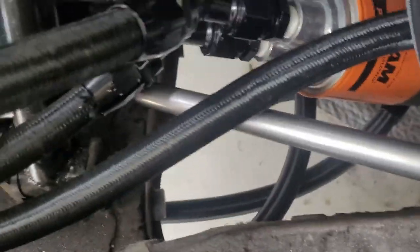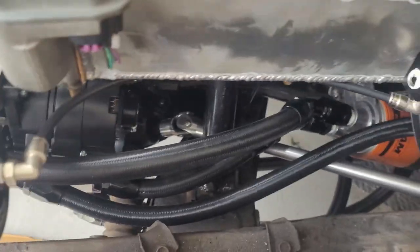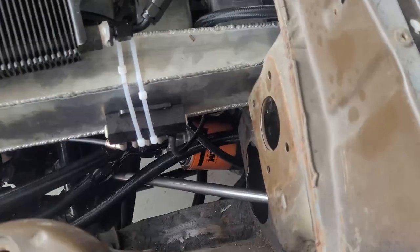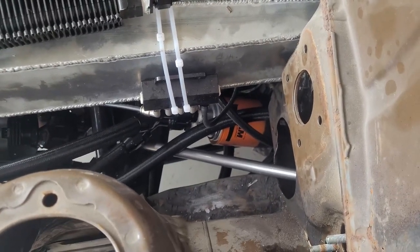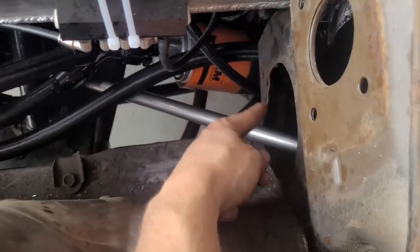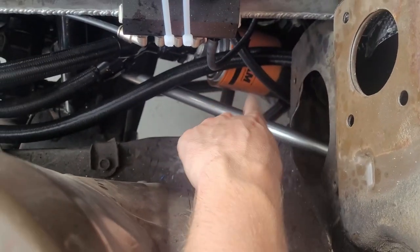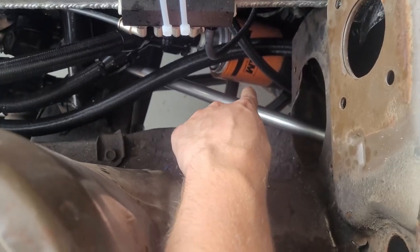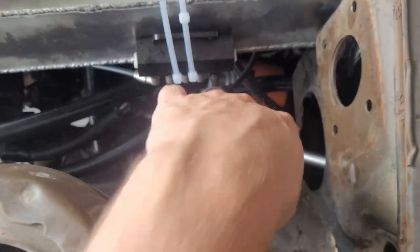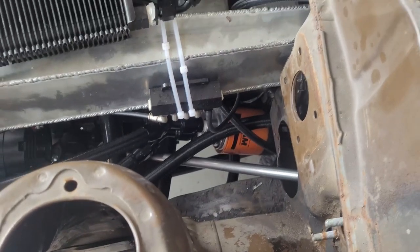So as you can see, we're connected there. It actually tucks under the motor mount, which is what I planned two or three years ago, and it even ducks under the oil filter lines. So it comes through, passes through, and that's about the trajectory out. We need to cut this down and start getting everything dimensionally closer to what we want. I'm trying to figure out if I want the secondary U-joint on this side of the firewall or inside — I'm leaning towards outside, because that's what production does and it makes sense. That way what's passing through the firewall isn't at an angle and then changing direction.